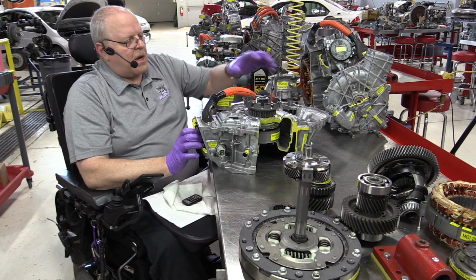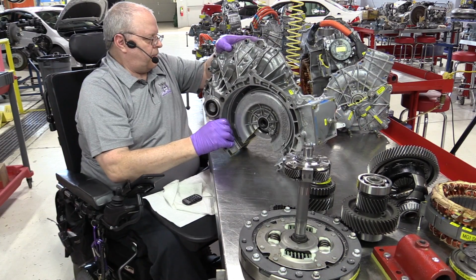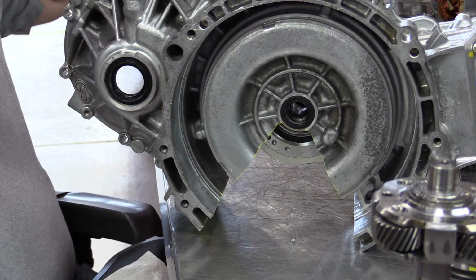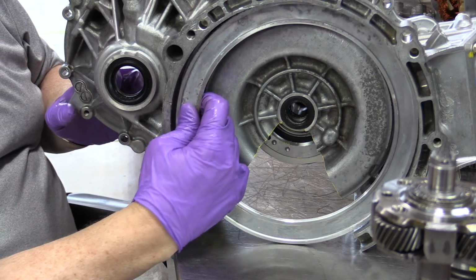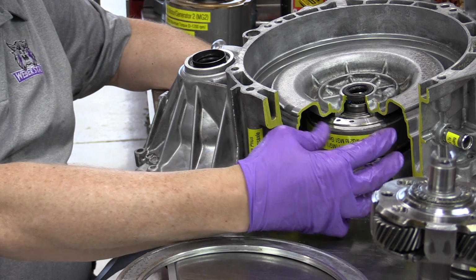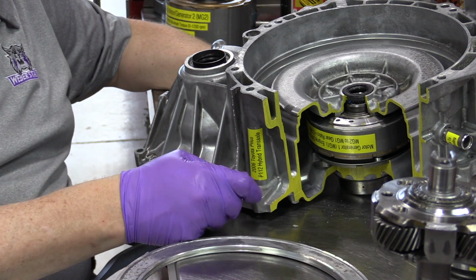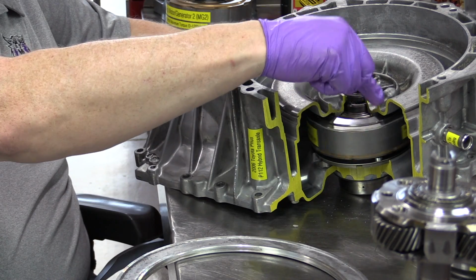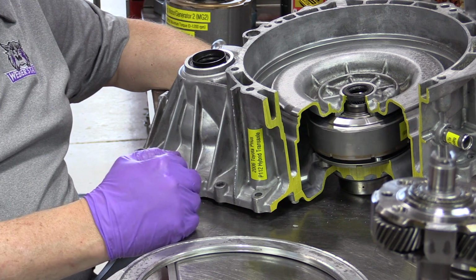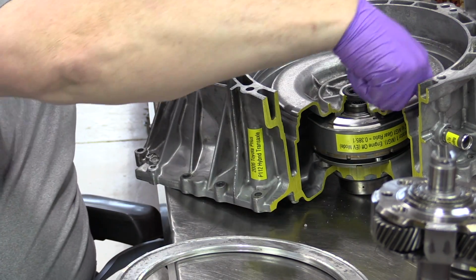However, I want to show you the inside of this bell housing area. As you can see on the inside of this bell housing area, this is the transaxle where I removed the coolant passage plug for MG1. If you recall, the MG1 Stator sits right here in these open passages. I don't put it in the passages here on my cutaway transmissions because it prevents me from rotating the rotor because of the magnetic field strength. But that stator is cooled by the coolant passages that go all the way around that stator.